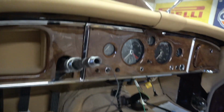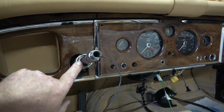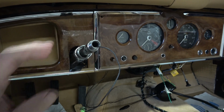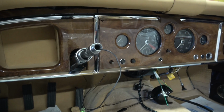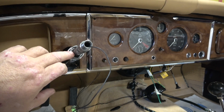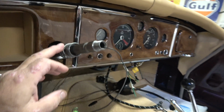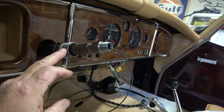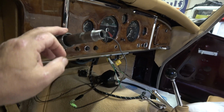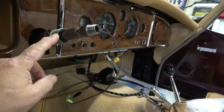And one of the things he did say, and I can see it, is if you look inside there, this has got a flat shoulder inside where the collet fingers go, whereas on the original it's tapered, so that as the collets go in, it bites down. Whether that will still operate with this or not, I don't know. Anyway, what he's going to do is, we've got some engineer's blue coming. He's going to put engineer's blue on this, and then he's going to put a thread gauge on it and see where the issue is, or we put the nut down.